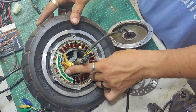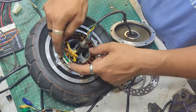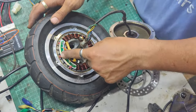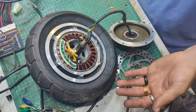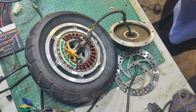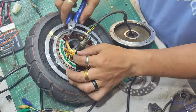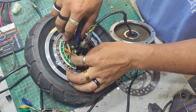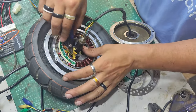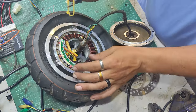We've got our yellow hall, black, green, red and blue here. There's no speed sensor - three hall sensors. It's the green one that's playing up, so that'll be that one in the middle there. It looks fairly straightforward. I've found my cutters - they're on the floor for some reason. This is all looking a little bit blackened in here.